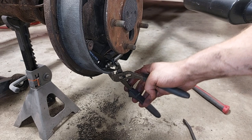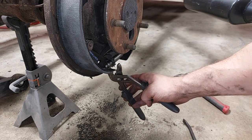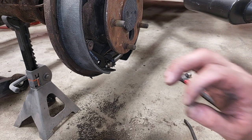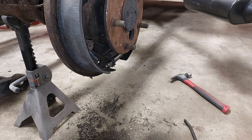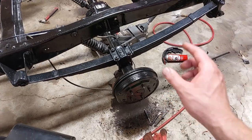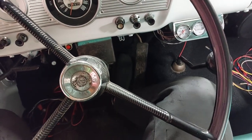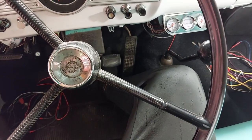On the bottom pin you can see you can move this little gear, and basically that'll spread the shoes apart. Spread them far enough so there's the very smallest amount of clearance where the brake shoe is not touching the drum. I've now completed both sides. I put a little bit of POR-15 on the brake drum so it looks nice and doesn't rust. Inside the cab we have really good brake pressure, so I think we're one step closer to taking this thing on the road.